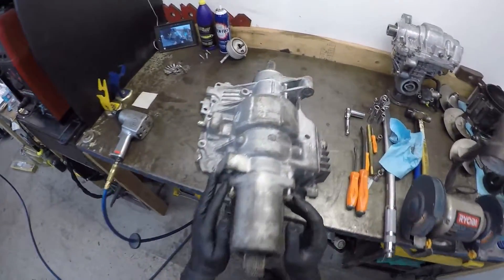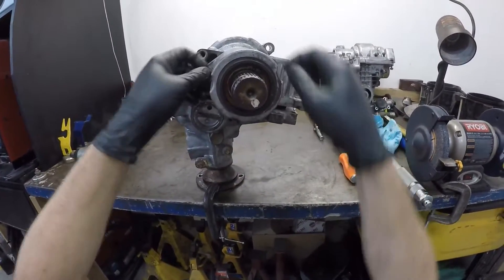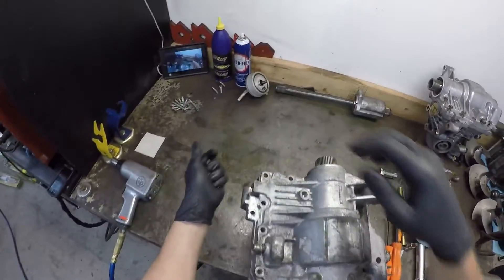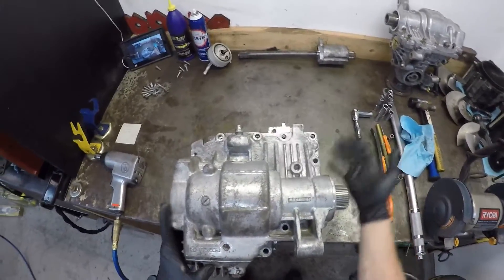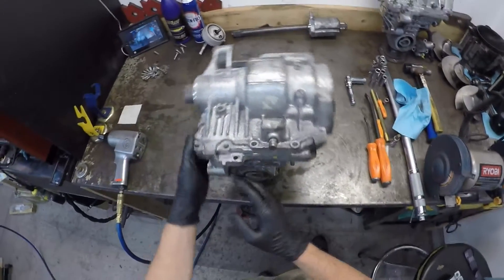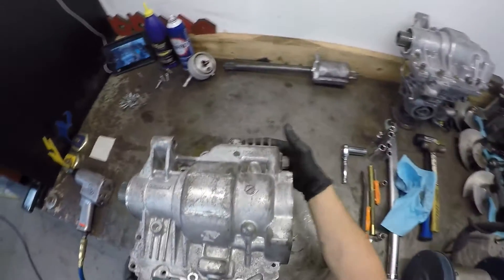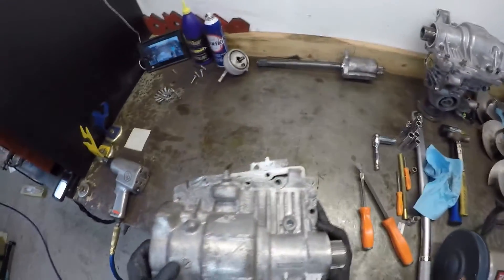You're gonna have five bolts holding your half shaft in place — one, two, three, four, five — and this will slide right out. Next, you're gonna have seven bolts on the top outside your cover and six on the back side. They're all 12 mil. Once removed, there are four locations to pry on this thing. Pry up on those surfaces, but try to avoid prying any surface areas where there's silicone or seal — those are machined surfaces.